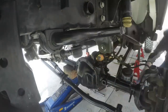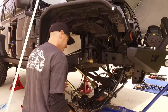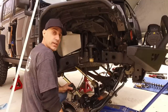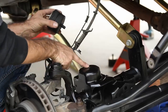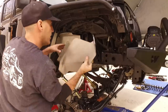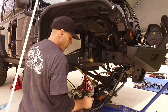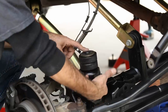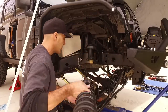I jumped back under the Jeep and started installing the upper arms, lower arms, and then got ready for springs. Now that we have the axle drooped again, it's a matter of getting our spring and new bump stops in. I did the bump stop kit a little while ago and I recommend it for anybody who puts oversized tires on their rig. The MetalCloak adjustable bump stop kit consists of these little pucks — you drill a hole into the perch and stack as many as you need. They recommend two pucks with 37s in this combination, so I'm going to up the bump stops to two — just a matter of drilling a hole into the perch and capturing it with a nut.